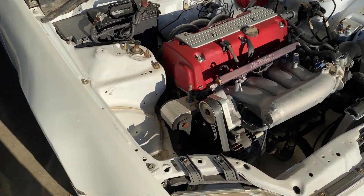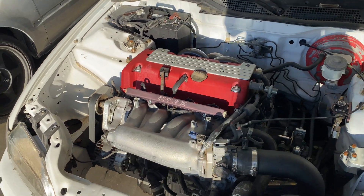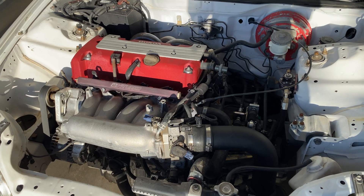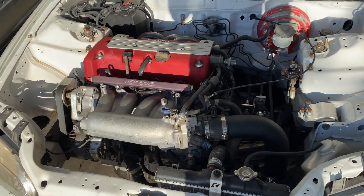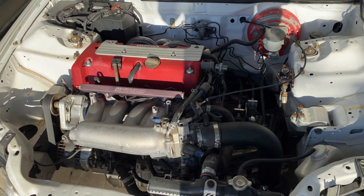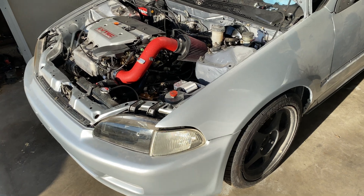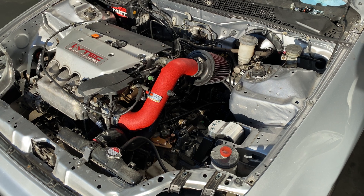As far as the blocks go, they're pretty much identical. They both come with Type S oil pumps and an 11.0 compression ratio. The only real difference from the A2 to the Z1 long block is the Type R cam — the Z1 comes with a stock Type R cam. Some people say the K20Z1 only pushes 201 horsepower, just one more than the A2, but that's because measurement standards changed in 2005-2006. Before the change it was rated at 210hp; the new standard lowered it to 201. By that same standard, the A2 would actually drop to 191 horsepower.